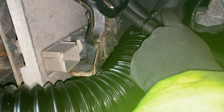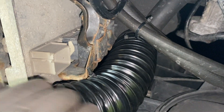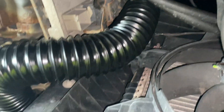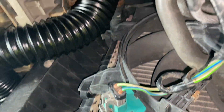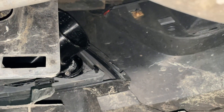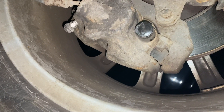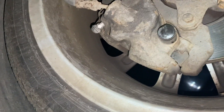I'd have thought that radiator hose probably contributes to heat soak with pod and cone filters, so hopefully the ducted air will cool that down as well and actually get around it to the filter. As for that other piece of ducting on the driver's side, some people in the install video suggested we could use it to cool down the brakes instead. I do have some brake upgrades coming in future videos - I've already got a lot of the parts, it's just going to take me some time to get them ready.